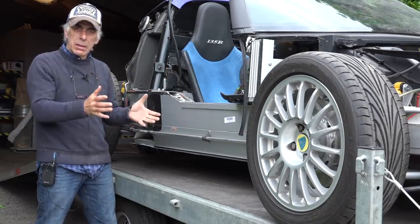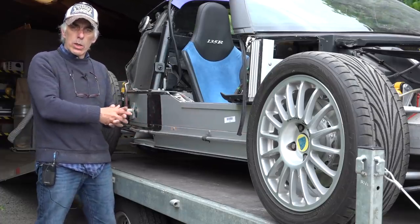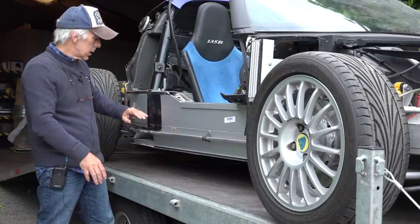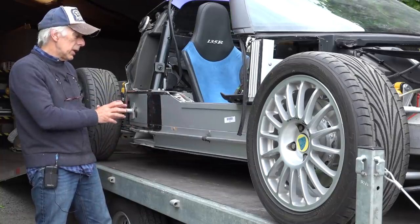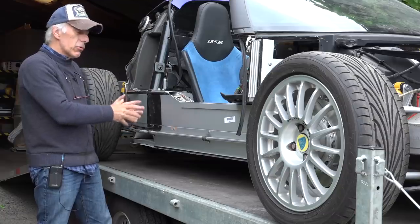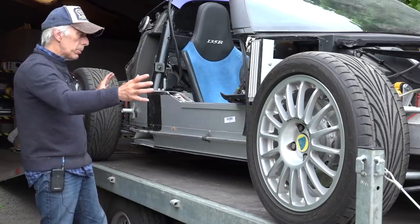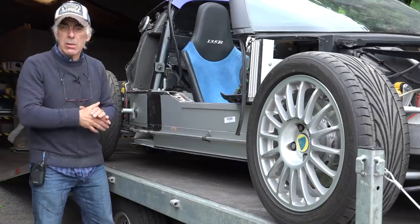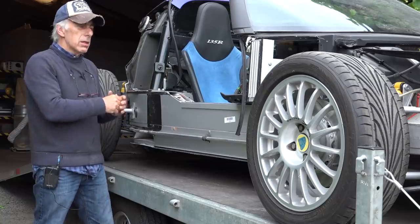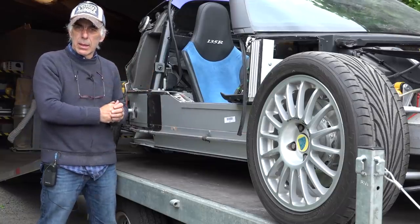The way we're going to do this is simple. First we'll trial fit the painted sill and mark where it sits so we know exactly where to place it. Then we'll take it back off, degrease, apply activator, put some new primer on and let it dry. Once dry, we'll apply the polyurethane glue in all the areas needed, then push the new sill into the glue and clamp it in place. Let it dry overnight and the sill should be properly fixed.